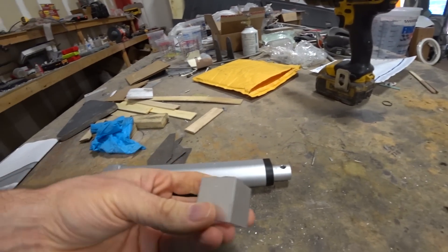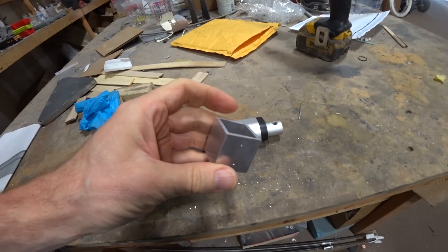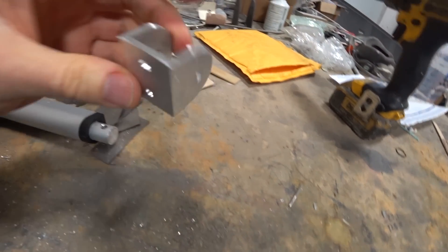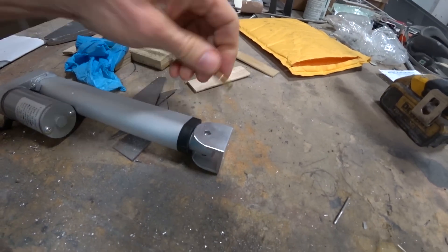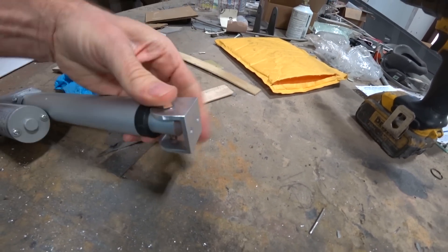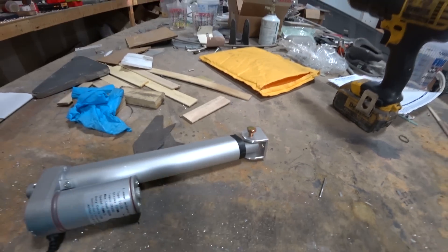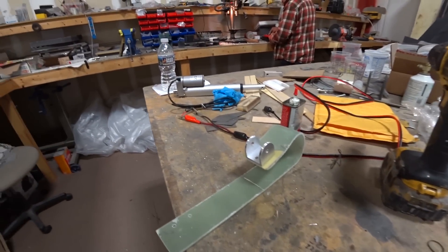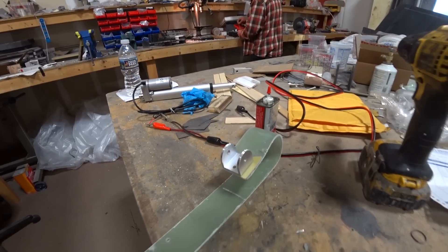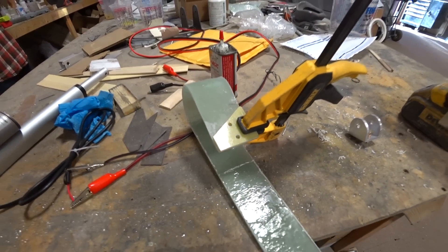Now it's Tuesday and my job is to work on more of the flight controls — creating another little bracket. This one mounts up to the end of the linear actuator that's going to be for the trim control for the elevator. There's my little bracket that I created; it goes through there with an AN4 bolt to hold it in place, and then gets bolted up to our little fiberglass spring hook thing that we created a long time ago.